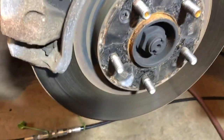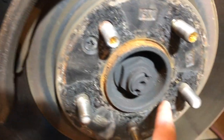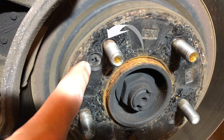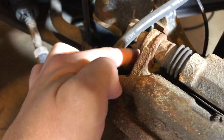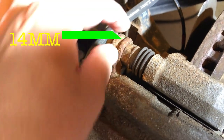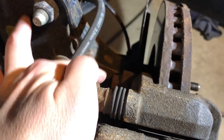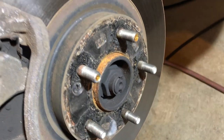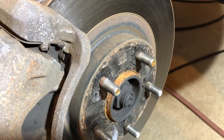If we just pan in right here, you will see that the brake rotors on these Hyundai Santa Fes in the front have two little Phillips bolts, so you have to make sure that you take those out. On the back here, these are 14mm, and if the pin spins when you're undoing the nut, you just put a little wrench in there to hold it. Those over there are 17mm bolts. So we've got 14mm, 17mm, and a Phillips — that's really all we need in terms of general tools.